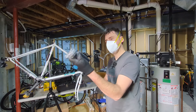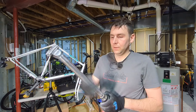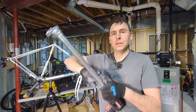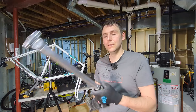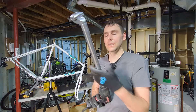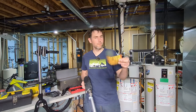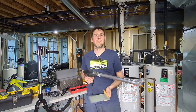Okay, the 1500 did a pretty decent job but it's not a mirror polish like I was hoping for. I could still see scratches in the aluminum. I think the next step might be to actually polish the aluminum — I'm going to get some polish and a rag and use the drill again to see how good a finish I can get. But actually I came across some 3000 grit sandpaper at Home Depot, so I'll try that before polishing.